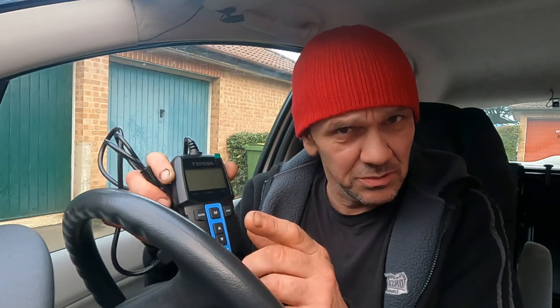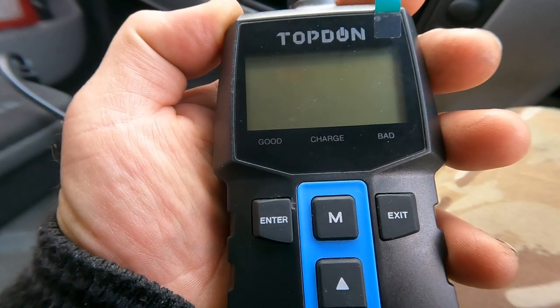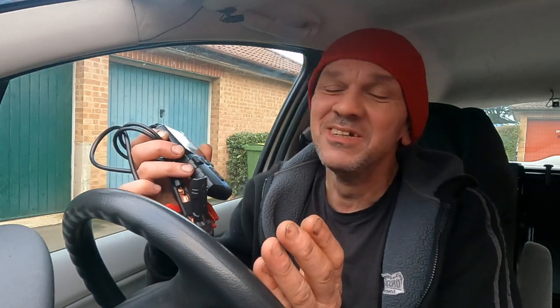Other than checking for voltage drops on your cables and making sure the connectors on your alternator are okay — because a dirty connector can make the voltage regulator burn itself out if it thinks it's not getting enough juice to the battery — this is going in the glove box of my car. You need to know whether it's the battery or the charging system. If you have a parasitic drain, check for ripple. I've already said it, so I'll say no more.